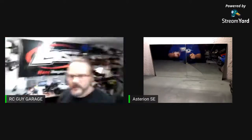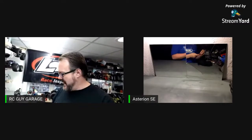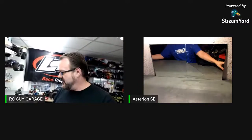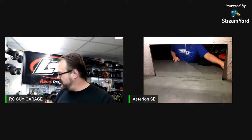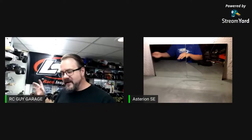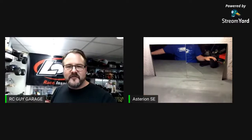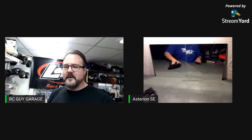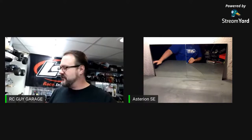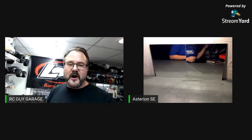So what do we actually do on this Hyper MT? We did one side new battery tray and frame mount. We've actually started modifying the front suspension, just by using a Dremel and modifying the actual hub itself. We modified the left side front hub. We do have to modify the right, but the modifications were just to see what was going to work while this thing was laid up and not in use. And now that it's finally in use, I will be taking apart that right side.